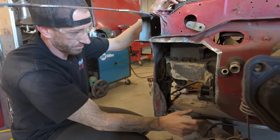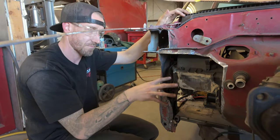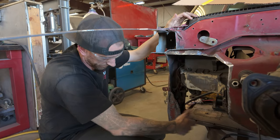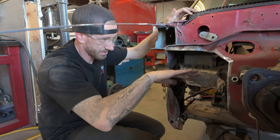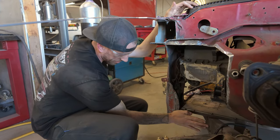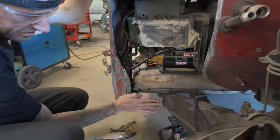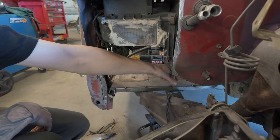This will all be filler, but I really need to get the tub in first. You've got to do the stuff that's functional first and then all the beautiful stuff around it. We'll make sure it clears everything, then plate and finish everything else off. The wheel tub will go here basically up to where the wheel starts to come in, and we'll plate that up. Down in here I want to do a piece that blends over this so you won't see any of it on the inside of the wheel well.